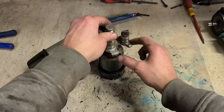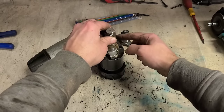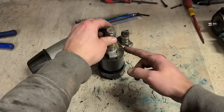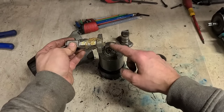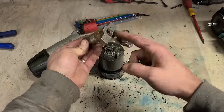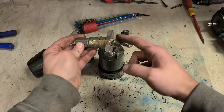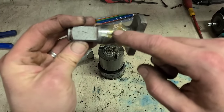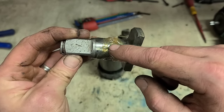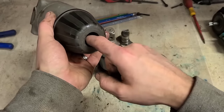And again, this will drop down right over the top of the anvil, spring back up again, and then slap on. And every time she goes up and down, any bit of grease that's on up here or works its way in will get onto the center here and will actually push up. So it'll eventually build and it will be pushed out through this little hole on the side here, which is actually inside your steel bush in here.